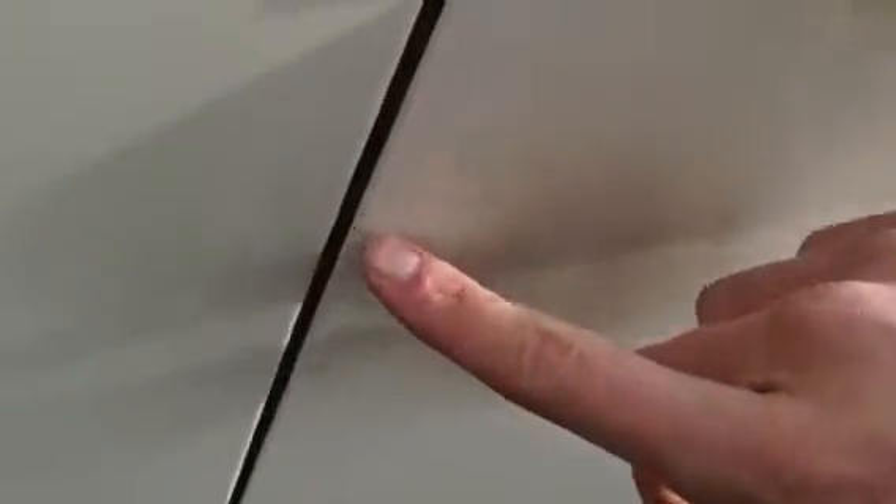There are tar marks that'll come off with a good valet, and one or two light scratches that require polish. One or two minor nicks in the door edge require some paint. There are some scratches just behind the driver's door — can't get my nail into them so that will need a mop and polish. Some light scratches as we move around to the rear arch.